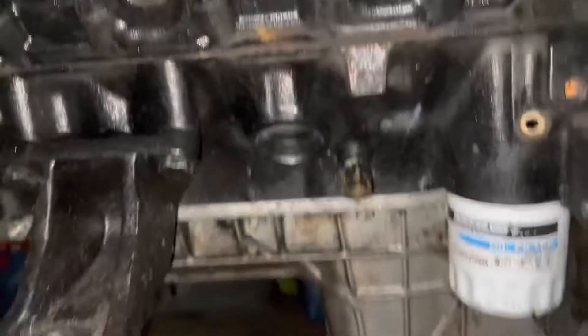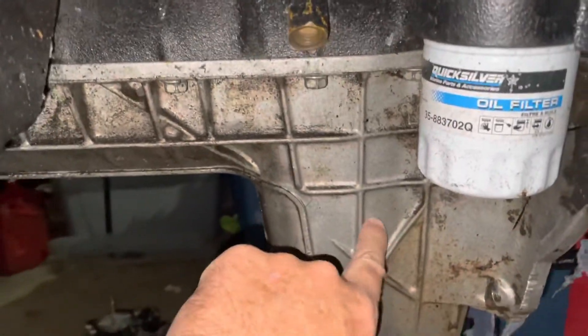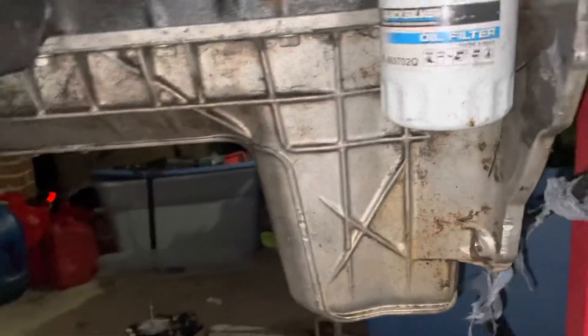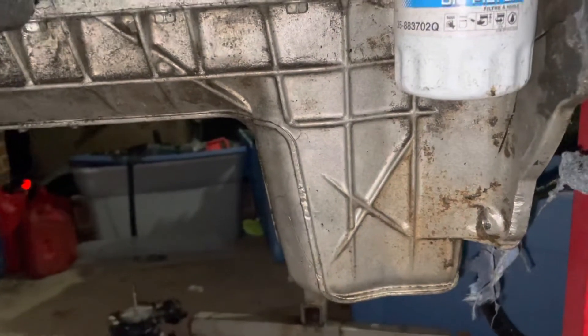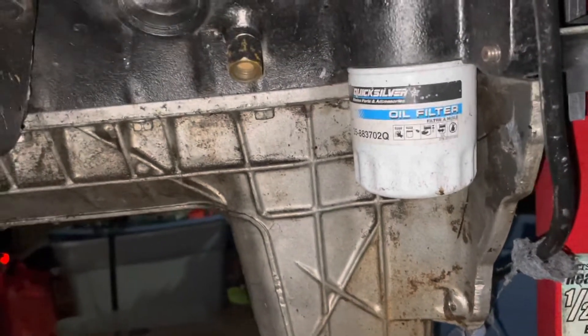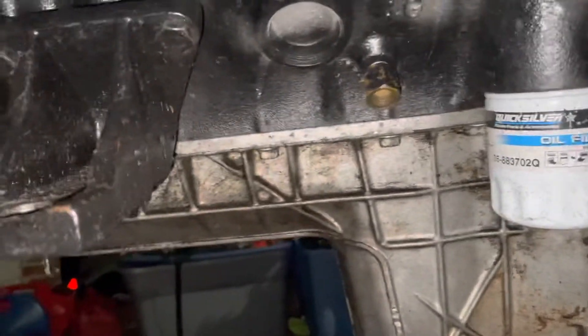So those are the three things you can use to identify a truck core: the oil pan is not painted black and looks to be a different oil pan altogether — I think the marine versions are not as deep. I may be wrong about that; I'll let you know in the description. And again, the core plugs are supposed to be brass. They're not — they're steel. So this engine came out of a truck.